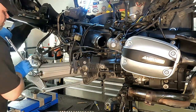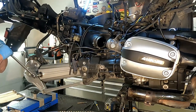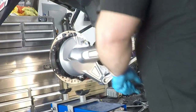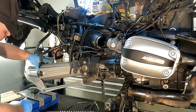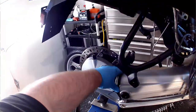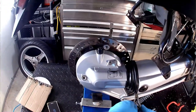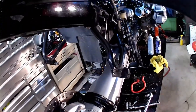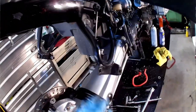We've got our 12 millimeter Allen key and our breaker bar, and we're just gonna see. And I'm gonna say the answer is no. Somebody may have put that back in there with some thread lock, or it has never been off before. So before we get the map gas out, we're gonna need to cut this zip strap down here on the boot. And this is what kind of led me to think that maybe somebody had that out before, but maybe they just lubed the driveshaft splines and put it back together.